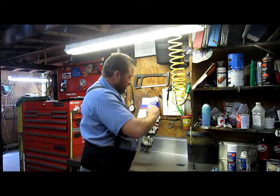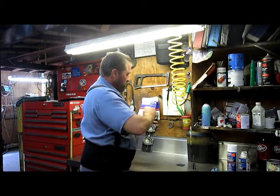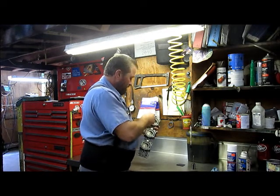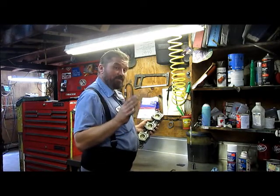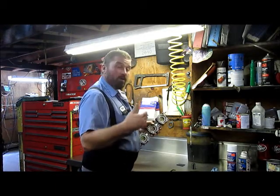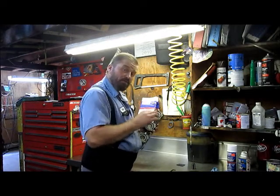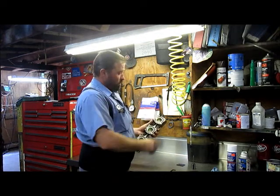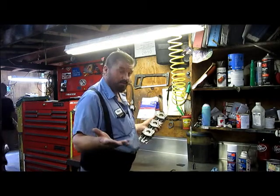This one is six and a half turns. Good ol' Gary — this motor is going to be a complete rebuild, so I'm going with what they usually have us start at, like five and three-quarter turns. This one's at six and a half, which falls into the range where a motor getting a little older sometimes has its displacement grow as it breaks in and you have to increase the fuel supply a little bit to make it idle right. So this one's out six and a half turns — the book probably says five and three-quarters or six turns, but we're marking this one at six and a half.